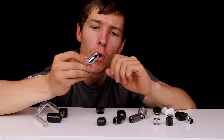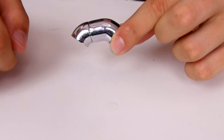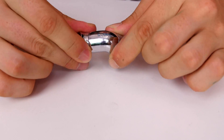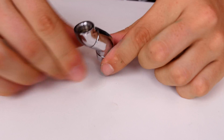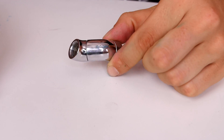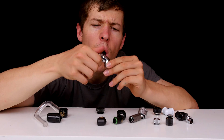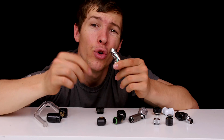You can also get rotary fittings, which are great for creating different bends that you couldn't achieve with a normal tube. For instance, right now I have a 90-degree bend, but I can make a really sharp turn just by rotating the fitting — essentially creating an S-bend. These fittings are great for those really tight bends that need to connect two points in the loop.